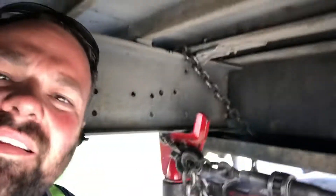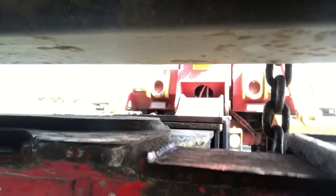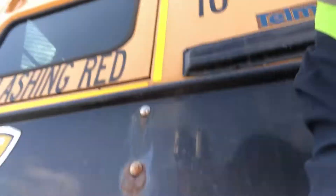I got my Omega rings around it, coming around the frame rail, chokered back here. They're going around that cross member, around the T-bar, back through it. There's kind of your overall view. I'm doing this with the tires still on the ground — all the tires are on the ground, my underreach is level. So we're going to go ahead and pick it up. It didn't change the angle, it didn't change our tension, it didn't make it any tighter or looser when we picked it up. I've got the ass end off the ground enough to tow it. Our hooks are still right there at the T-bar.